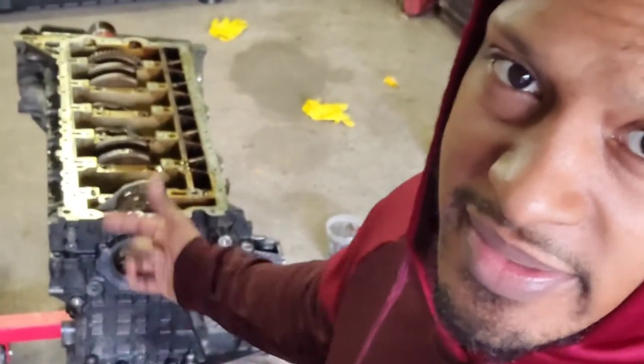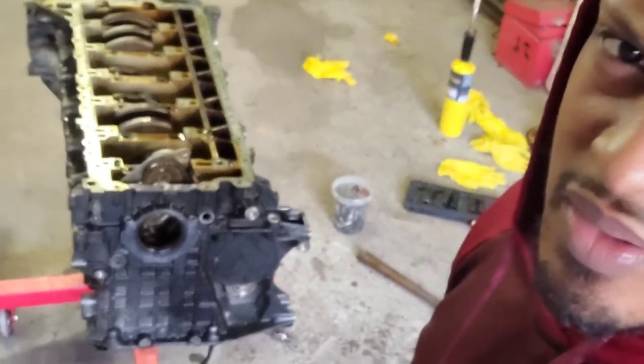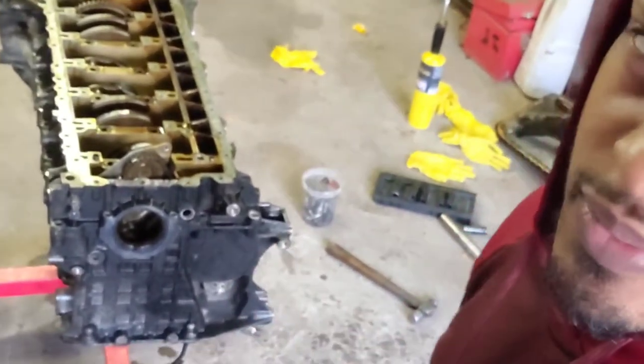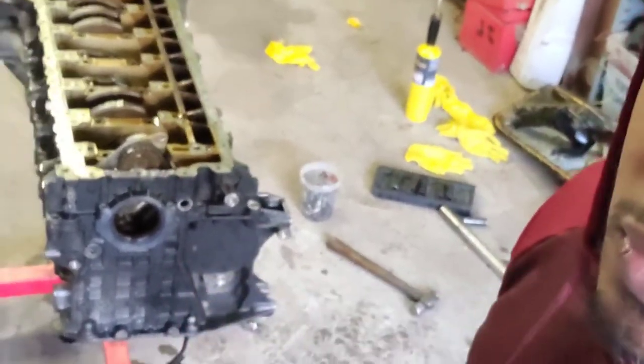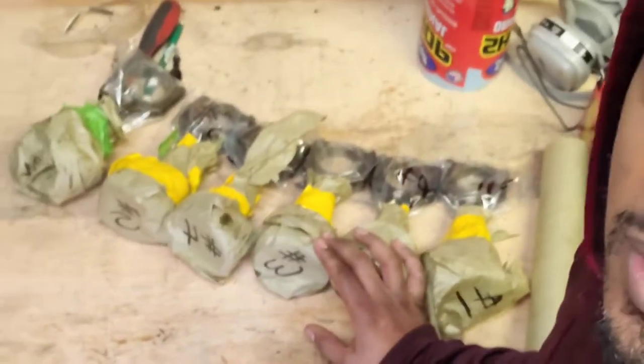What is up world. So I've been tearing down the motor on my live feed, my phone died and I'm back. Basically the head is off, the oil pump, the windage tray, all that's off, the bed plates are about to come up, and I got all six pistons and rods out, got them numbered and labeled right here.